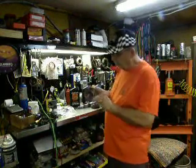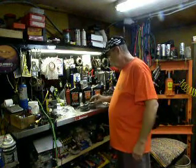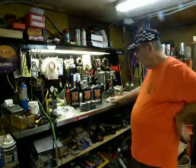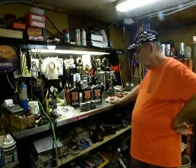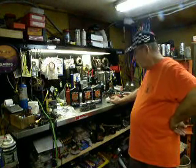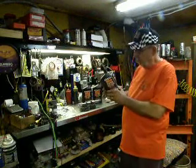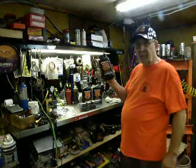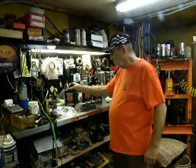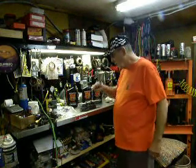Same with this gear, back in front. He wanted to change this out, so I bought it because I'm going to use it. It's a 380 first gear and a 231 second — I'm going to try this. He was using 75-90 Brad Penn oil from me — synthetic. Really works. I'm sold on it now, for sure. That synthetic's up there.